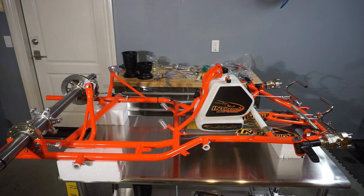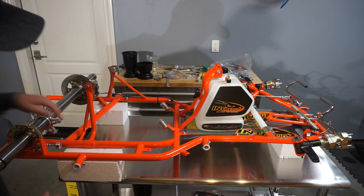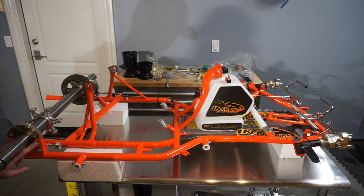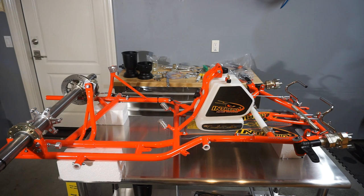This is a 30mm frame, it's got a 50mm axle and 25mm spindles, and all the components are just top of the line. It's got a floating brake system, torsion bars, heel stops — it's got a lot of stuff. Here's the seat strut and you can see it's mounted onto the north-south rail instead of the rear crossbar. The purpose of that is it puts all the driver's load more essentially neutral on the chassis, instead of loading onto the axle. Also the cassette bracket only goes halfway up the axle instead of encasing the whole cassette — that's to soften the chassis on the back and make it snappier out of corners so we're not lugging our engines down since we're already struggling for power.